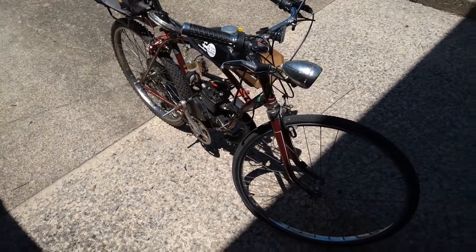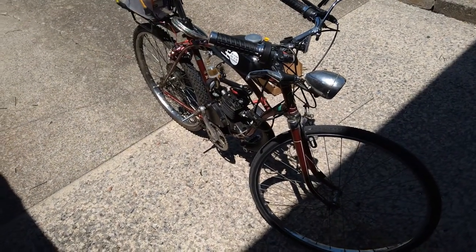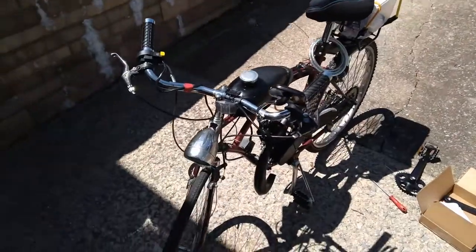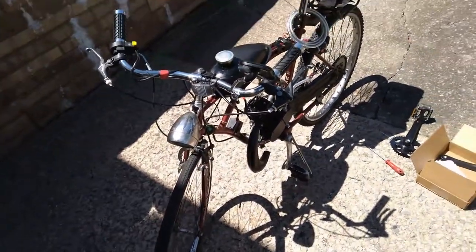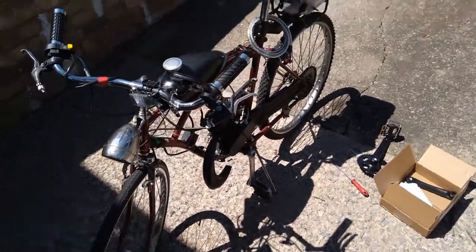So unfortunately, those two little batteries are not enough. They don't provide enough current to drive a relay. So to that end, I've got a very small, itty-bitty little baby power sport battery that I just picked up at the parts store. It was the smallest one they had. It's just a little 12-volt, 50-amp battery, and I'm going to wire it all up. I'm going to put a 10-amp fuse on my positive before the switch, and then hopefully I don't blow anything up.